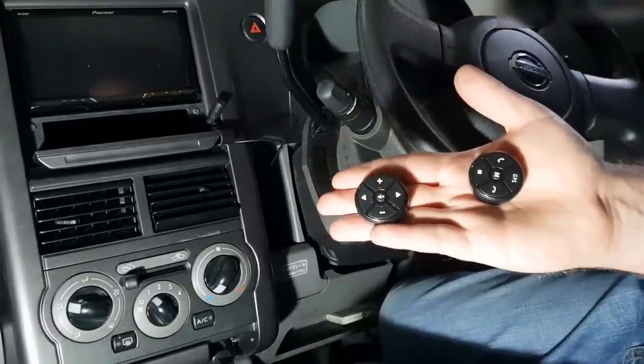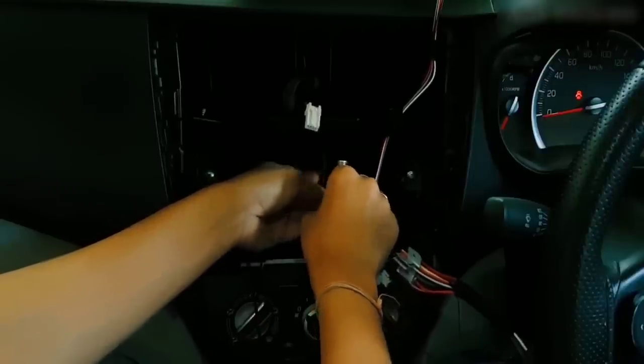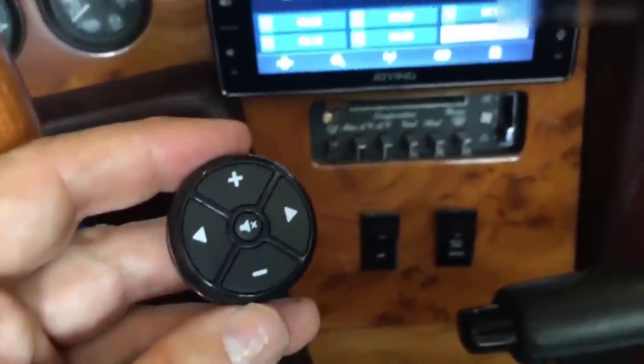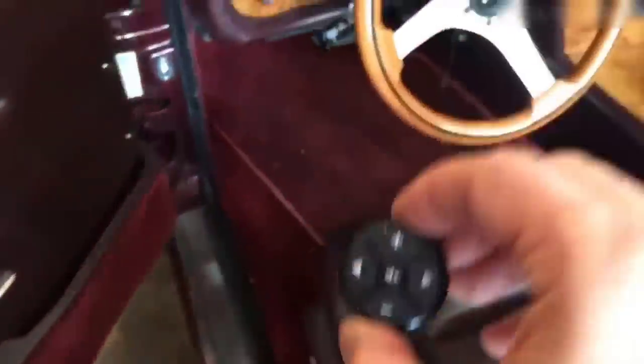This product is for those who do not have buttons to control the car radio. They are powered by batteries. To make the buttons work you need to connect the control unit to the radio, which is done quite easily. Once you have connected everything, you must teach the boombox to work with the buttons — you must read the manual of the boombox. After everything is set up, the working buttons can be attached to the steering wheel using double-sided adhesive tape.